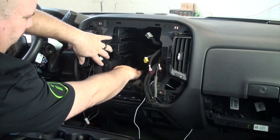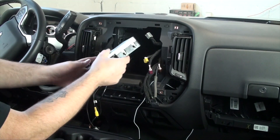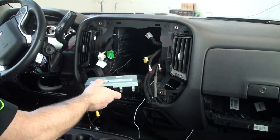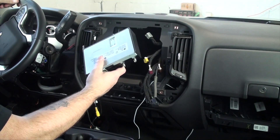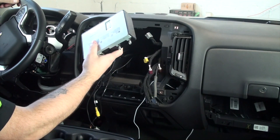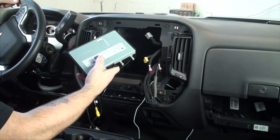This opened up the whole bottom, and what we're going to be doing is installing the OnStar unit on the bottom. Now it's tempting if the customer says they don't use OnStar and it's not activated, so they're not going to put it in. But what will happen is the vehicle won't start unless the OnStar is connected.